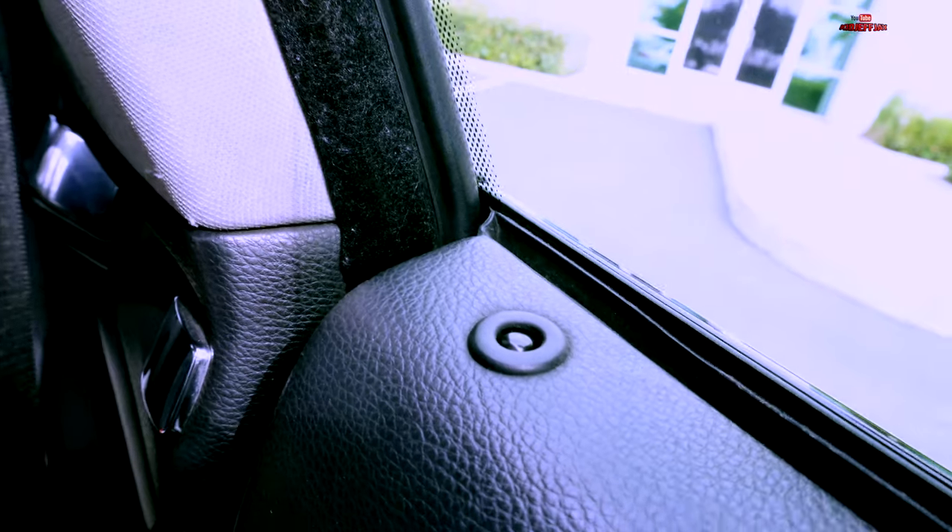There you go — I know you guys heard that beeping sound. Now put the spare key back and use the alarm remote. Press it and you hear the sound. So now you've seen how to do it with the spare key. If that doesn't work, the second step is your fuse might be dead.